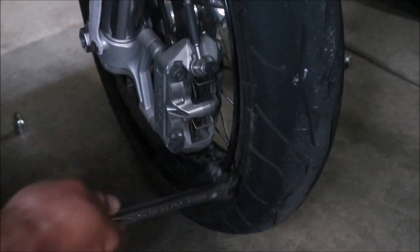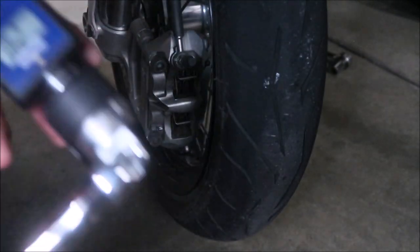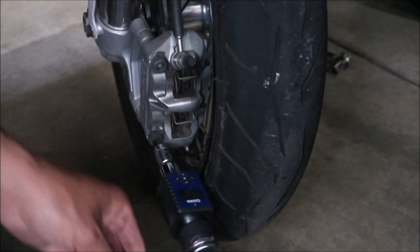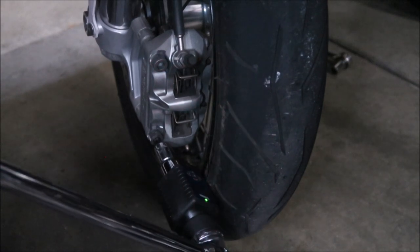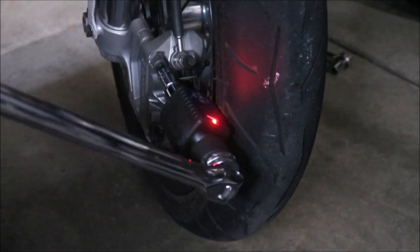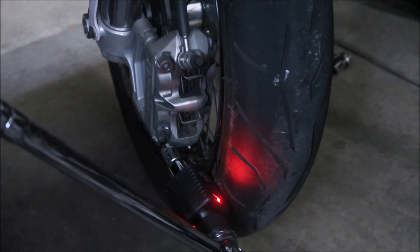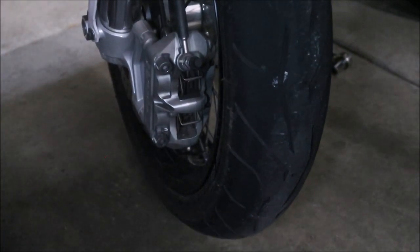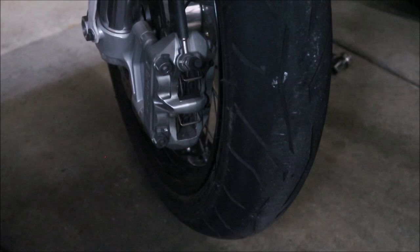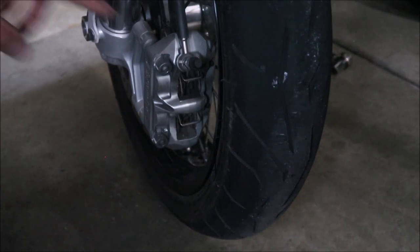From the factory they put these marks on the bolt. Now we're going to tighten it with a torque wrench to 24 foot-pounds. I'll do each a little bit at a time. The lines are roughly where they were before, so it was properly torqued and our torque wrench looks like it's properly calibrated — that's a good thing.